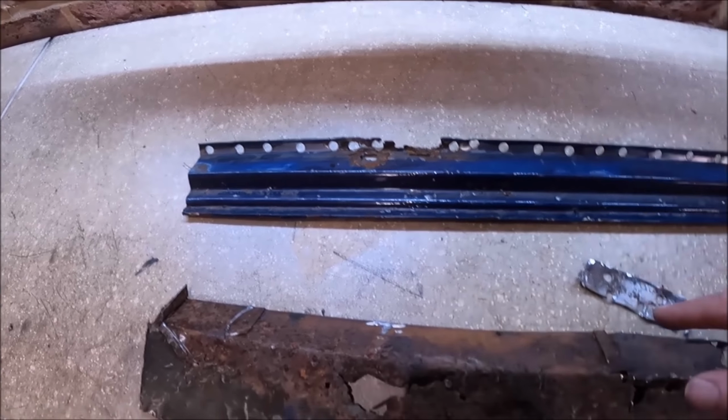and you might notice at the front bottom part of the A panel is out. There's the bit that came out. Now, I'm not going to do an Ed China on you and replace half an A panel. It's just down the bottom here where it joins to the sill, it was just rotten. And the A-panels are coming off anyway, so I just cut it out for ease.